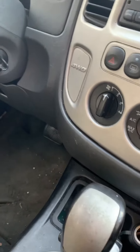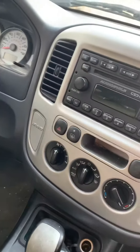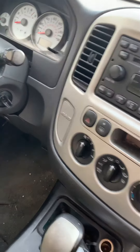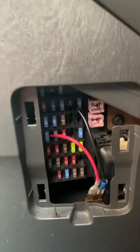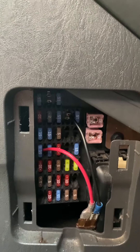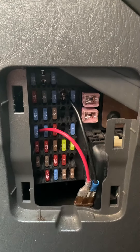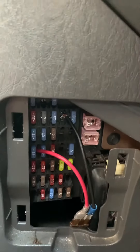When you turn it back on, the radio still retains its memory, so it's kind of a shortcut. The whole project will cost you less than $5. Fuse number seven is the accessory delay relay circuit, and the fourth fuse down on the far left is your subwoofer. Find the diagrams online — just find one that turns on and off with the key and make sure it's fuse protected. Thanks for watching.